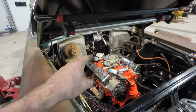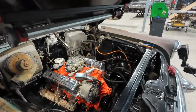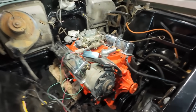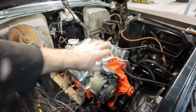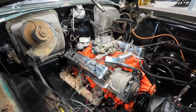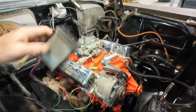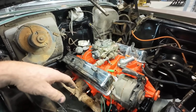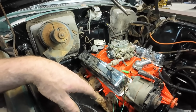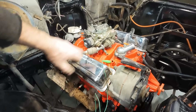Come back, we're gonna throw the cap on and then I'm gonna walk him through the old small block timing, whatever, I can't remember what it is. People will make fun of me. I should know that. Anyways, the timing's on the intake, so we'll just follow that. We'll check that all our plug wires are good. And then cap a bunch of these vacuum leaks that we're gonna have. And then we'll be ready to test fire it, see if she fires up. Might just foil tape everything for now, just so we have no vacuum leaks anywhere.